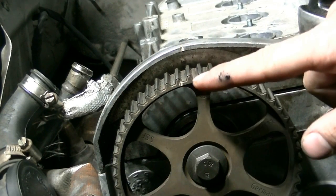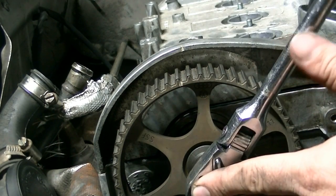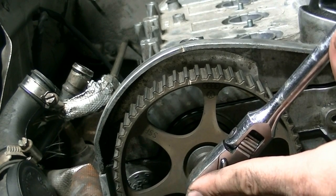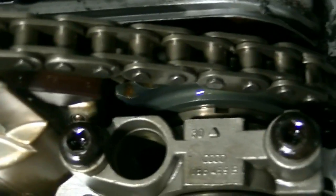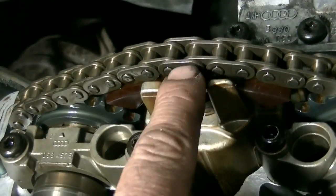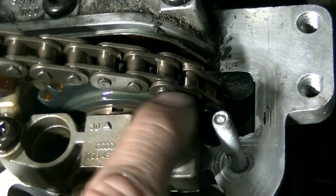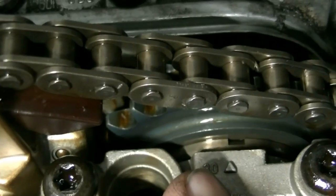Now I'm going to line up this mark on the camshaft. Threw on our valve cover so we can get a closer look at the marks on our camshaft chain tensioner. This is not far off — we're talking a quarter of an inch. This side is still a little off, but that makes sense since the tensioner is not pressurized and therefore not applying any pressure to this chain. Once the car gets going and fills up with oil, these will get closer and line up. If they were off by clearly a tooth — more than this — that's not going to make up the difference. They're off by very little, so I'm pretty sure it's just the tension that's supposed to be in here.